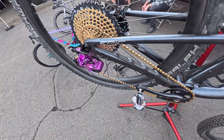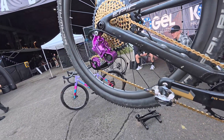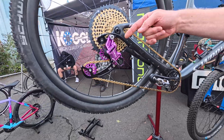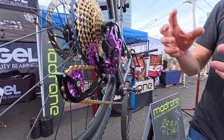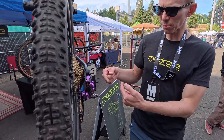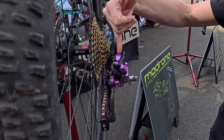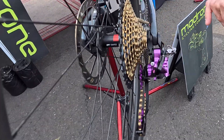As you can see, it's mechanical. We're pretty proud of it. I think it's shifting really well. It uses ball bearing pivots for each of the pivots, which helps us get rid of all the slop in these joints — an inherent source of shifting trouble. We have a pretty clever mounting design here that also eliminates all the play.